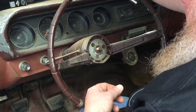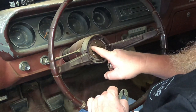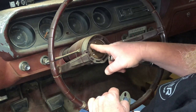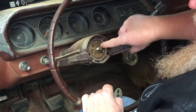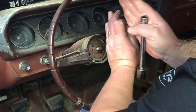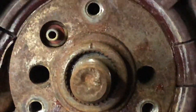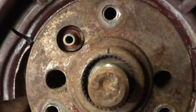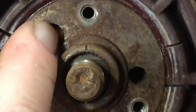We've got this isolation ring here and your little turn signal ring. Now you'll notice right here, this is the horn contact, and it's at about 10, almost 11 o'clock position, with my wheels pointing straight ahead. There's a little tiny line right here at the very top of the 12 o'clock position — that means the steering was pointed up, keeping everything straight in alignment so you don't end up with a steering wheel that's cockeyed. And over here, that's your steering wheel contact.